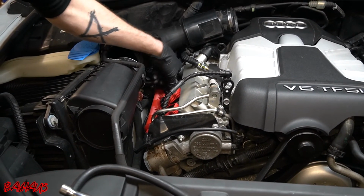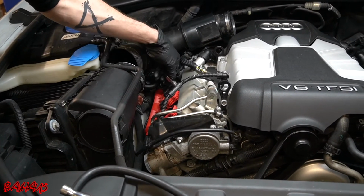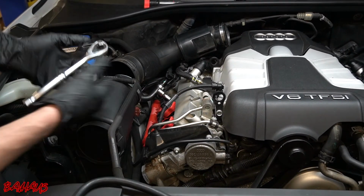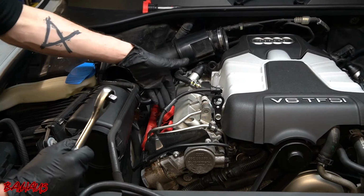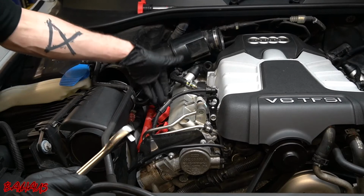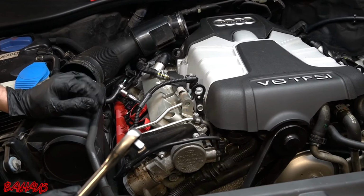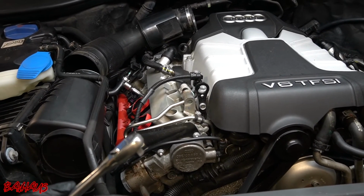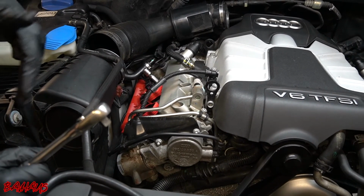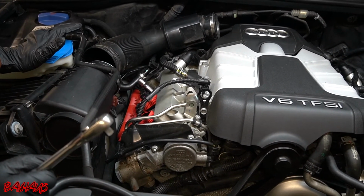So what I got out of this is that there is an issue a little bit larger than a regular misfire from this cylinder 2, which we already knew, because if it was just a small misfire, it would have just been something related to a coil pack or a spark plug. So no new information there. We have our relative readings where we can actually see the percent of compression drop between multiple cylinders. We know that the rest of the engine is running very healthily.